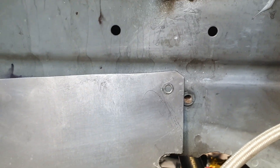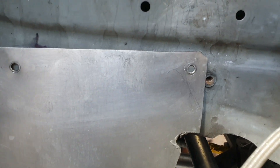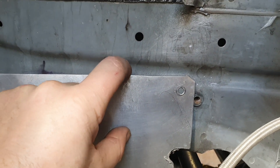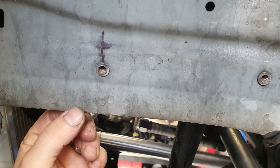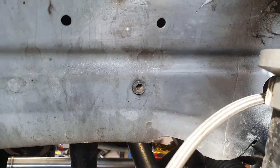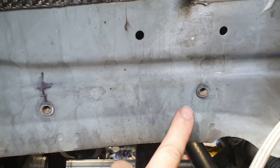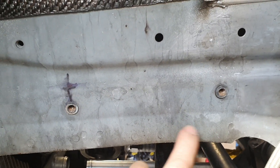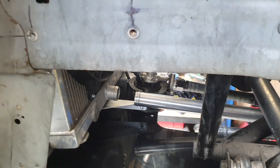Another thing I've just looked at — this panel doesn't need to be as big as this. We've got a lot of stuff doubling up. There's a whole strip of aluminium that doesn't need to be there because there's the edge of the chassis rail — two layers of relatively thick steel. Drill and tap into that will hold, and eventually one day when it lets go we can put rivnuts in instead. So we can ditch these rivnuts, drill and tap into the chassis rail, shorten up this panel — we're talking tens of grams saved, not much, but some.